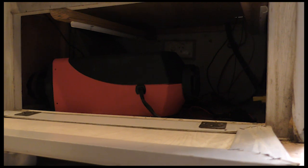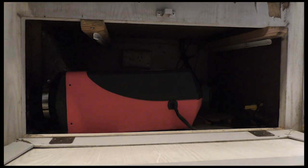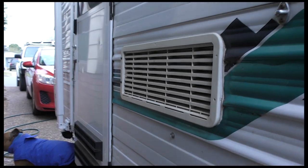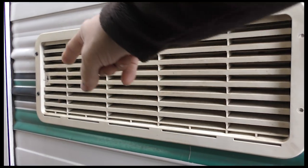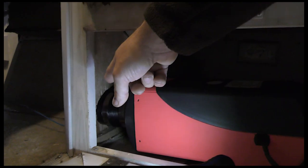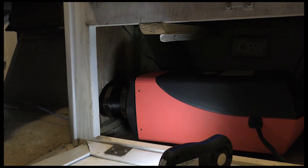It's not ideal because obviously we've got the fridge trying to cool up top and the heater trying to heat down the bottom. Now one of my friends asked if I should be leaving this door open for the intake fan. But right over the back there is a hole in the top right hand corner and I can actually feel cool air coming out of this space. I did used to have a three-way fridge in here, and on the outside that hole is just inside a vent. So there's no concerns about it being a closed space — it can suck cool air in from outside, in through that hole, into the heater. I went a little further in than I probably should have, which made it a little difficult to get the intake pipe in. The vent is right there and the heater's right there, with only about three or four inches of pipe where they have to meet.